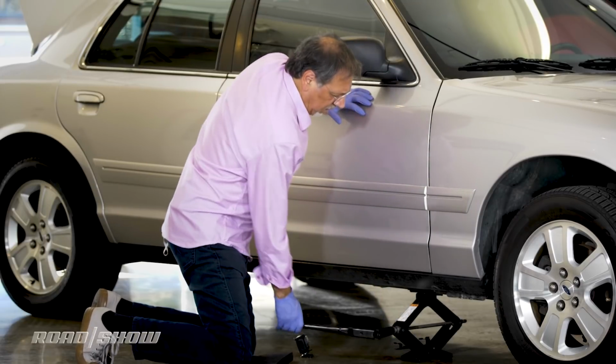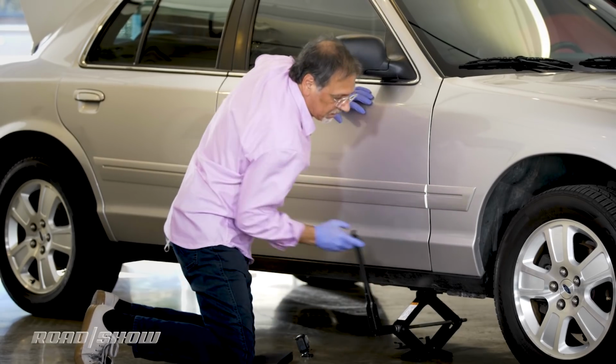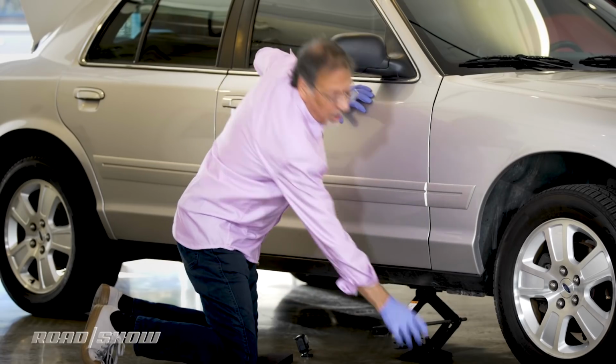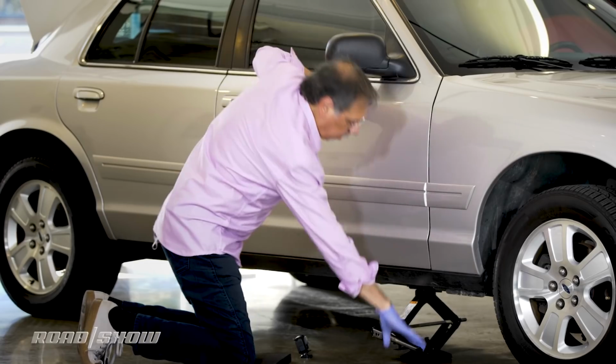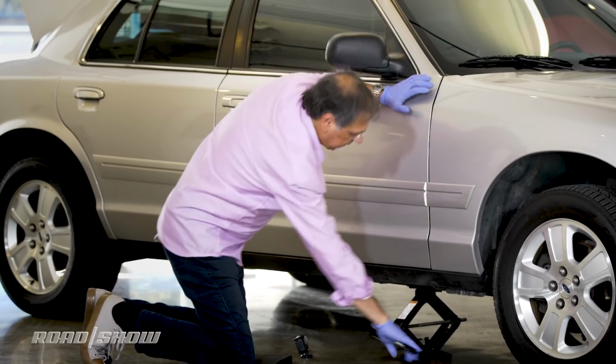How much do you jack the car up? Just give it enough so you've got some daylight underneath that tire over there. It's not a precise thing. Your jack, if it came with the car, will have plenty of travel so we can get that particular model of car up in the air, including the amount of suspension droop that occurs as the car goes up.